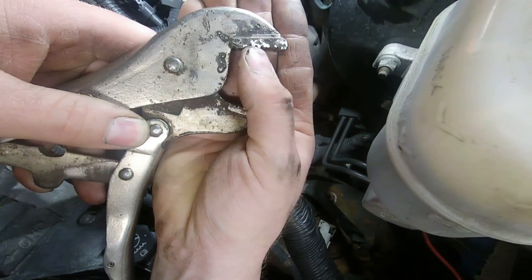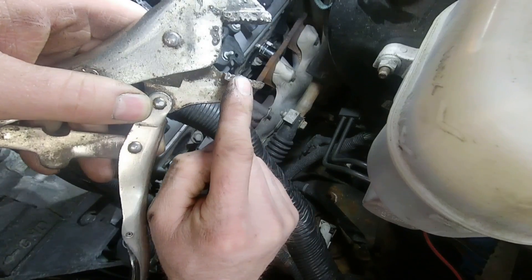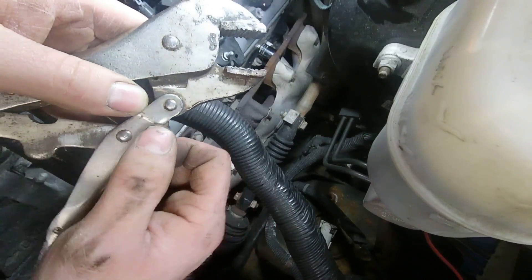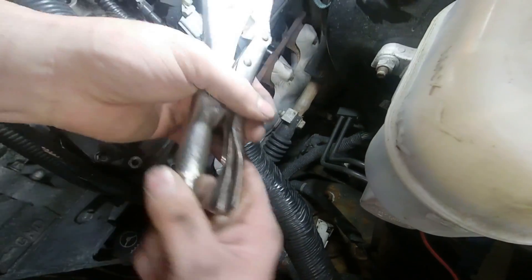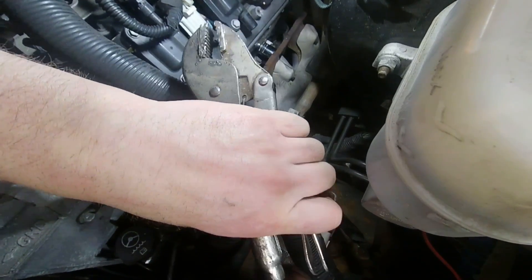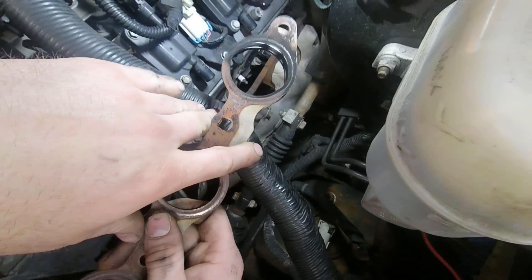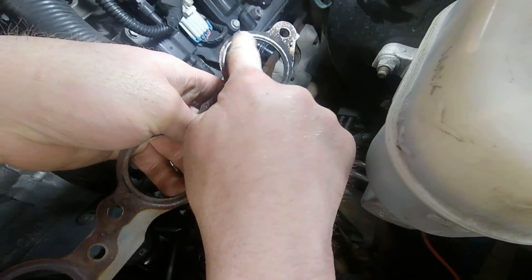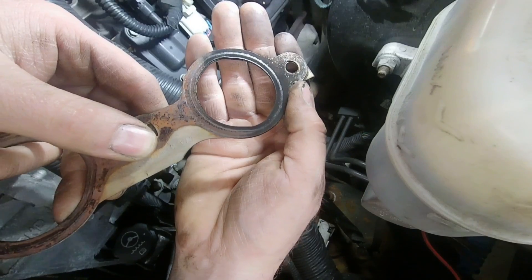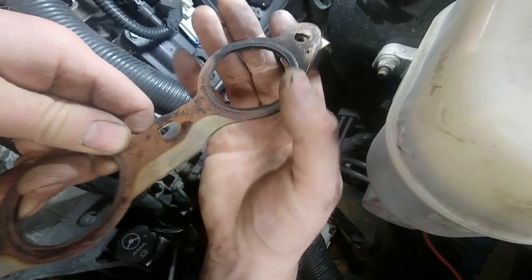What I'm going to use is a vice grip. Notice these jaws are straight — they go straight across. Most vice grips have a curved jaw, but these straight-jaw vice grips grab much better than the curved-jaw ones. The curved-jaw ones really struggle to get a bite for removing studs. I highly recommend you get yourself one of these — I'll put a link in the description. Here is the gasket itself — you can see all the black around it where it was leaking, but also a shiny spot where it's making full contact and actually sealing.